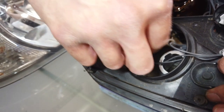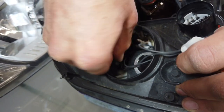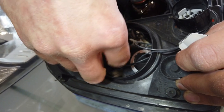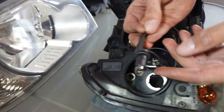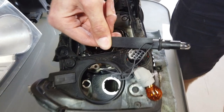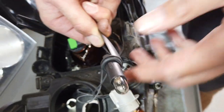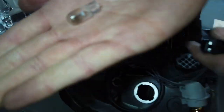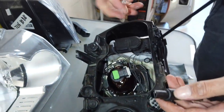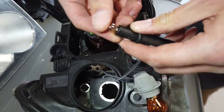Now we're going to get that spatula stick out - give it an anti-clockwise twist and it should unclip. There you go - you've got that long stick. At the end of it you've got a little wedge bulb - pull that out and that's a little sidelight bulb. You could upgrade these to LED - we'll put those on the website.